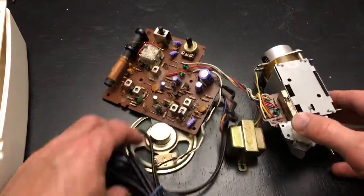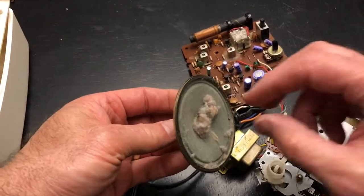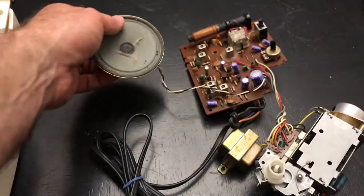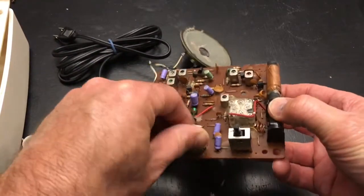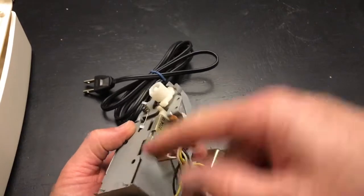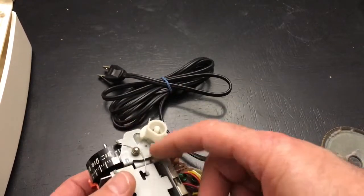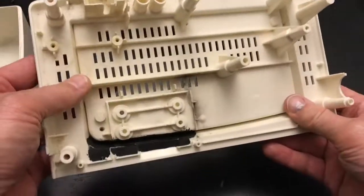We've taken all the parts off - that's the clock, that's the radio, that's the speaker, and there's the mechanism. That's 40 years of garbage on the speaker and you just kind of brush it off. Use a Q-tip or a light soft toothbrush - you don't want to get too aggressive. The radio is supposedly not working. I'll show you later - there's the switch that turns the radio on and off. The cause is usually that switch, the volume control, or the AM/FM selector.